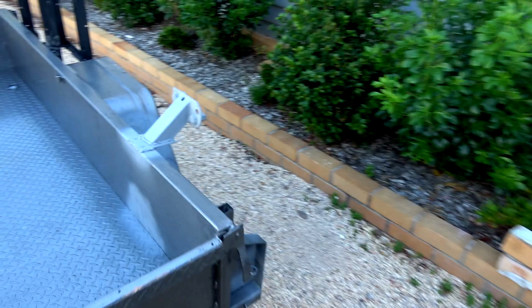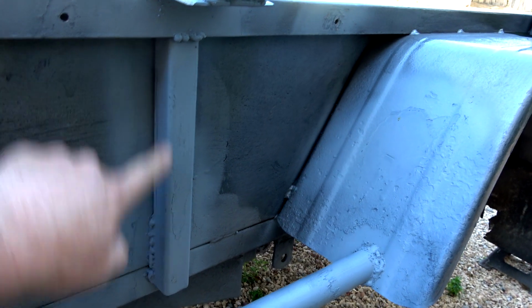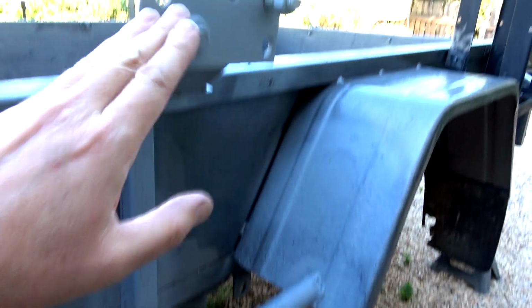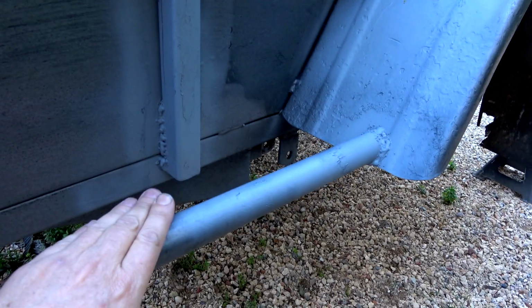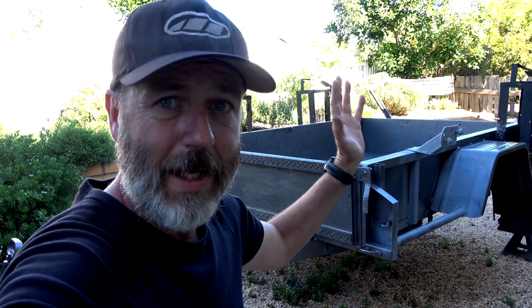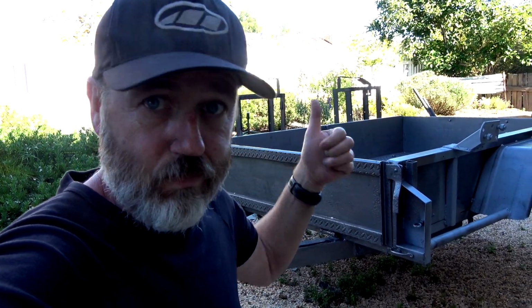And I've got the spare wheel carrier. So I just modified this, it's now welded on there. I've strengthened up this section here to stop this from bending in like that. So that's now bloody rock solid. And it fits on there bloody perfectly. So there's shared weight between that and that. This here, more so for the lateral, I think you would call that. And that, but it's actually sharing it all. I wanted to go over the top because the last thing I want to happen is to have a spare wheel, something fail there, spare wheel fall off and go and knock some kid, kill some kid bloody on a street somewhere. So I've done the overkill on that. And I'm happy, it's rock solid.